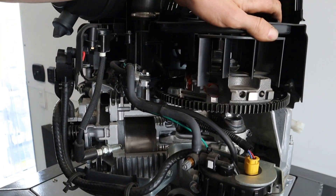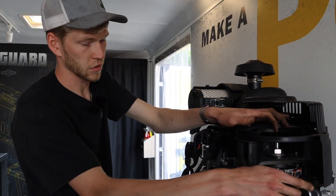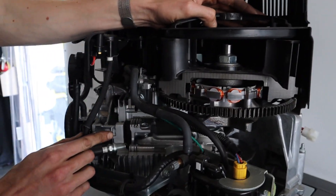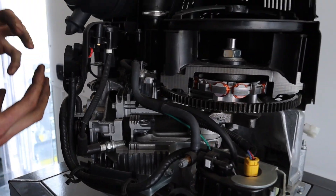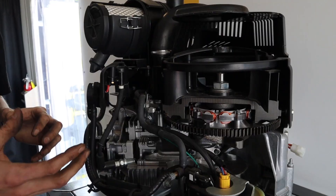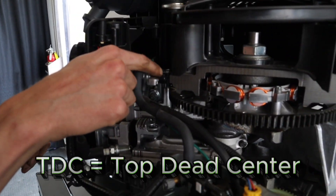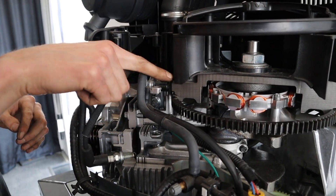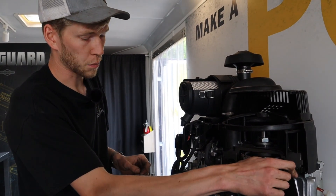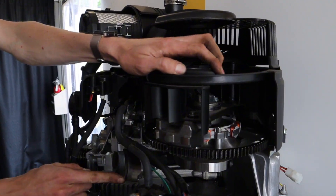You can see it's completely closed now. Now the piston is coming up - this is called your compression stroke. This is where the magic happens. As that piston approaches the top, it's compressing that gas and air mixture. Once it gets to the top - called TDC or top dead center - your spark plug ignites a spark, which is sent from this pickup coil from the flywheel spinning. It sparks at the end of that spark plug and ignites that gas and air mixture, which then drives the piston back down.